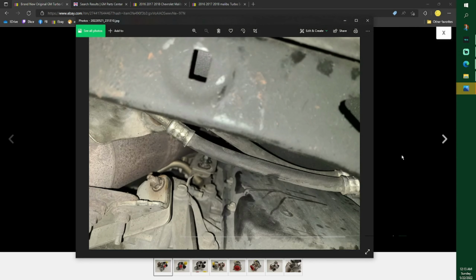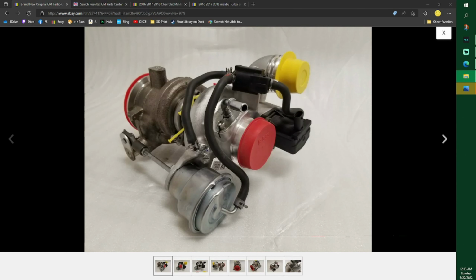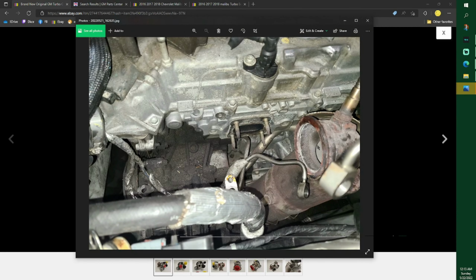So again, I did drain the coolant. Oh, you can see both bolts there. I removed both of them and that just slides back and forth however you want it. It doesn't slide amazingly, but it lets you push this to the side. Now that back panel right here won't come off, but I push this to the side. That way the turbo could pull clear out.